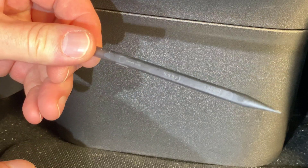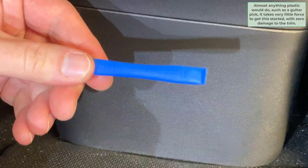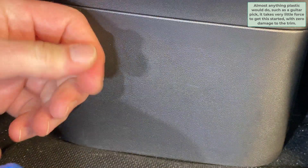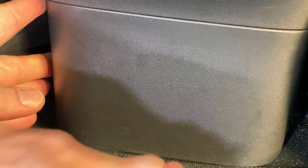I did have to turn off mobile data sharing in the same Safety and Security menu, and type in my Tesla password. That allowed me to get the car to go to sleep. Heard a loud clunk after about 5 minutes — the wheel well lights went off, the ambient lights went off. Now I'm leaning over making sure not to lean on the rear seats. I've got my iFixit spudgers, and from videos I've seen, prying at the upper right is the way to start.